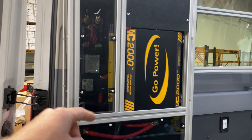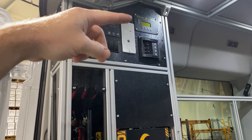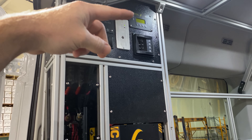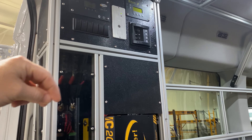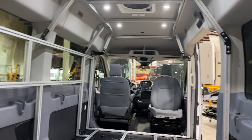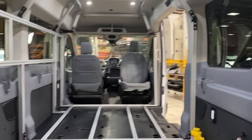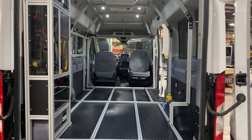In the power tower back here, you've got 300 amp-hours of AGM power and a 2,000-watt inverter with all of our different controlling systems. Up here you have your solar, your inverter charger controller, solar AC distribution, and a CO2 monitor to keep you safe. And this is one of three bricks of switches that are located throughout the van.